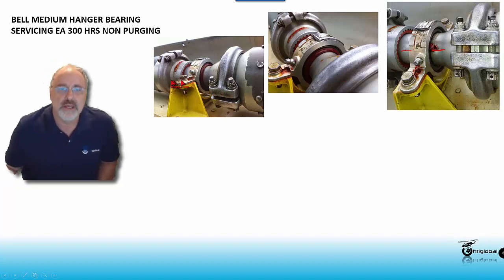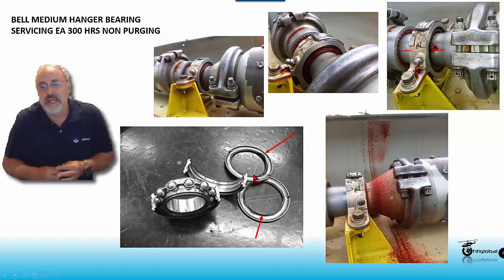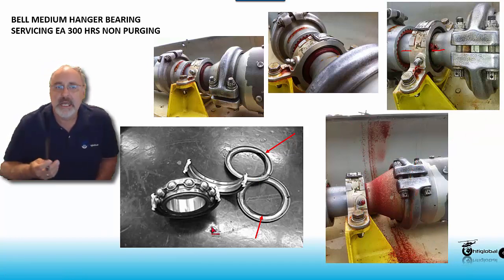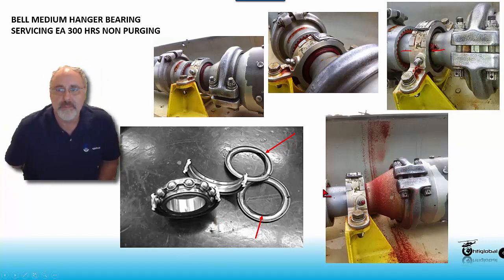There are many places in the helicopter where you pump a lot of grease and remove the old grease until the new grease comes out — that's when you know you've purged it. Not on the hanging bearings. The hanging bearings are non-purging; you're just going to replenish whatever has been burned or drained out on the 300-hour interval. When you try to push too much grease, many times you're going to damage the seal. The seal is the weakest link on the bearings. If you put too much pressure while lubricating, you can debond the seal — it can come out, causing an issue where there's no more grease. Remember, this is an alignment bearing, and if that bearing comes apart, you are going to lose the anti-torque system. Be careful and follow the manual when you lubricate these hanging bearings.